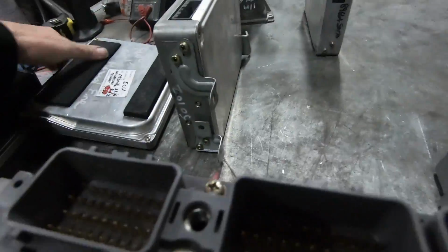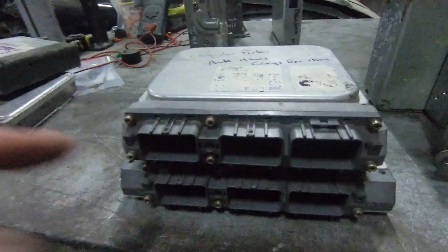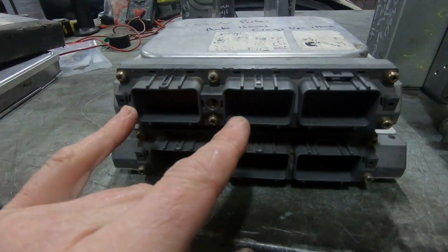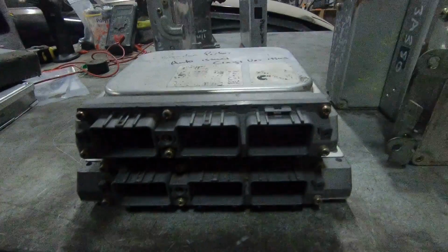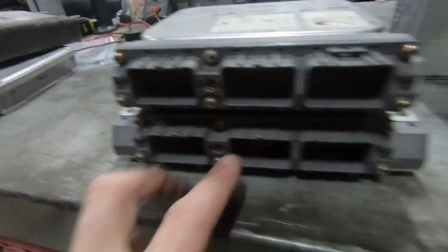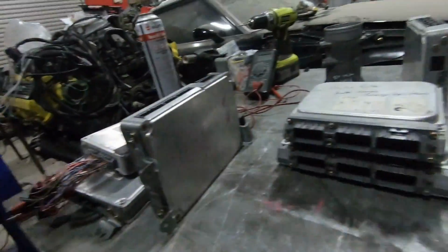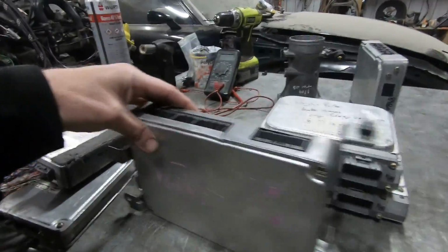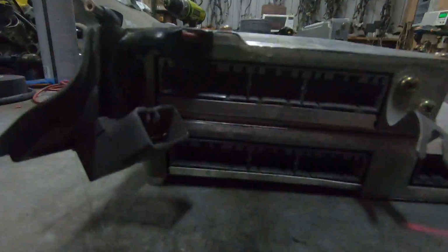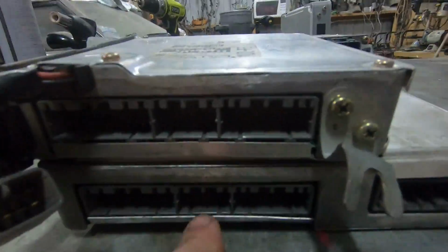141 Crown. Soarer. 40-40-40. Even though this one's an 80, we call it a 40-40-40. On many diagrams, that's actually an 80. Differences in looms. This one, the top one, the Soarer, these are all in the engine loom. These two are together in the engine loom. This is separate in the body loom. Kind of doing its own thing, but not quite. Different pinout, same plugs, different pinouts, extra plug on the end.